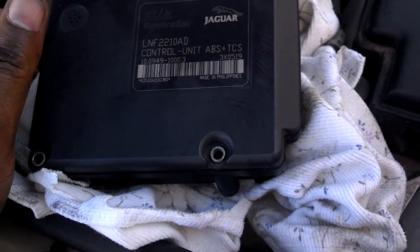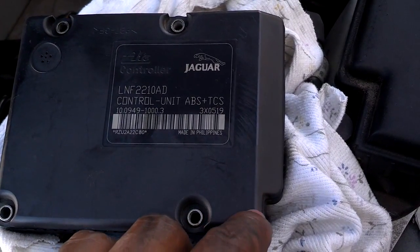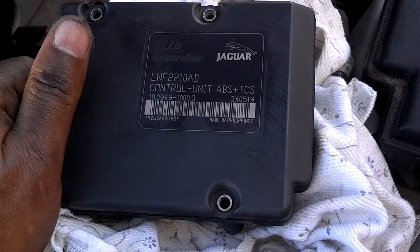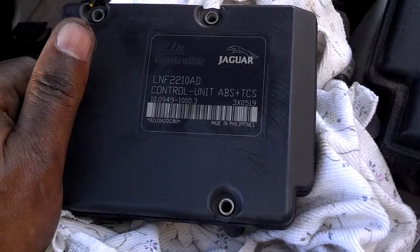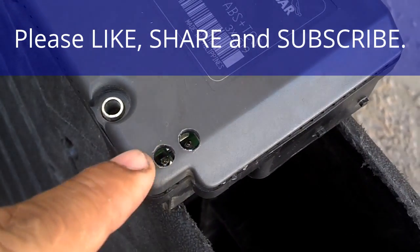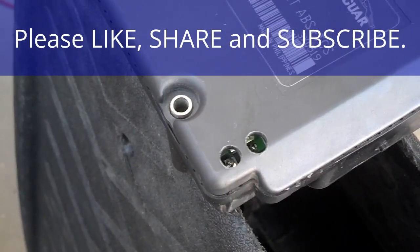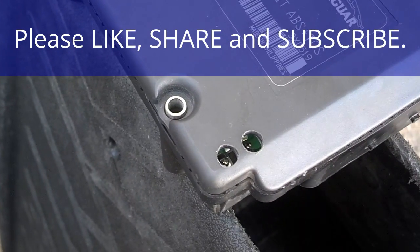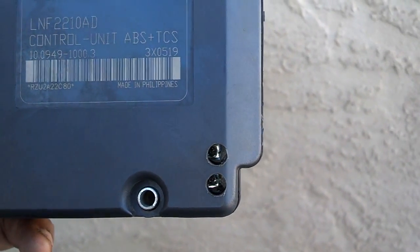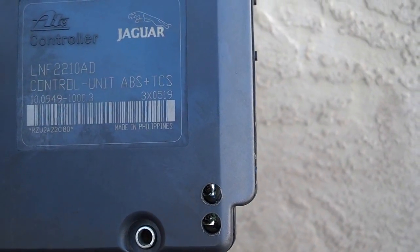I'm going to try another approach: I'm going to drill two holes right here — one at the corner and one a little bit over — to see if I can see those solder joints. If I can, I'm going to try to heat those two solder joints up and plug those two holes to see if the unit works. When drilling through this plastic, make sure you put less pressure as you get closer to breaking through, because the drill bit kind of breaks through suddenly and you don't want to damage your control board. Here are the two holes I drilled, and if you can see down in there, those are the two notorious solder joints behind those two holes.